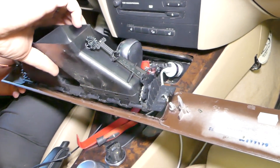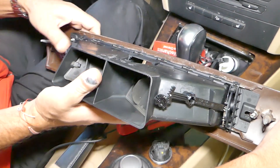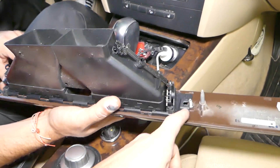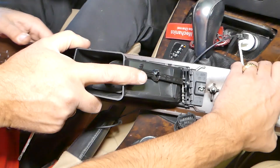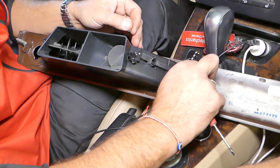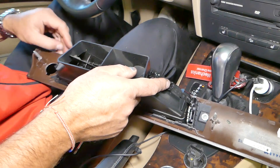This is the center dash vent. When you're ready to install the replacement, you need to get it in, push it all the way in, and everything has to be lining up perfectly — all the clips need to click in place. You can hear that click, that's what we need. After that, all you have to do is install the two nuts and get those tight. Installation of the trim piece will be in reverse order from how we took it apart. Thank you guys for watching, please subscribe, and many more videos to come.